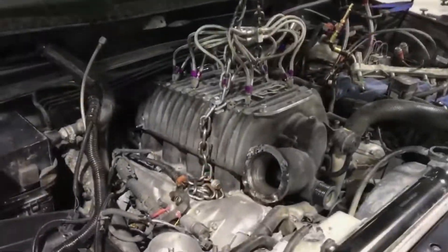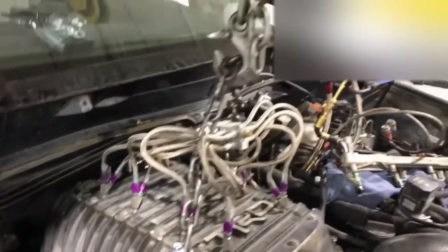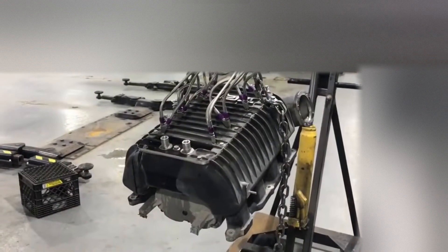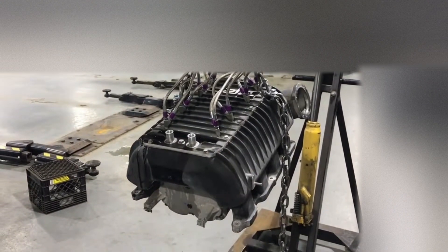The three on the outside are pretty easy. Once all the supercharger bolts are removed, strap a chain across it and hook it up to a crane so you can pull it out of the truck. And that is how you remove the TRD or Magnuson blower out of a Tundra.